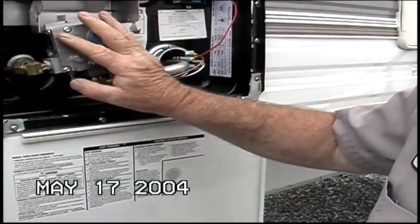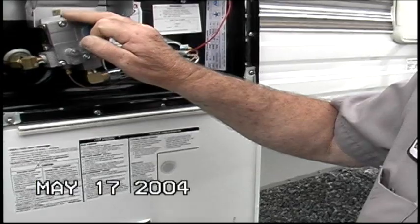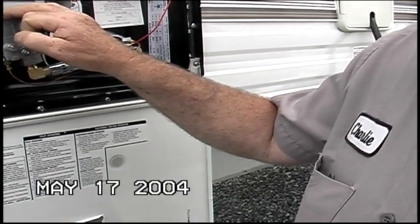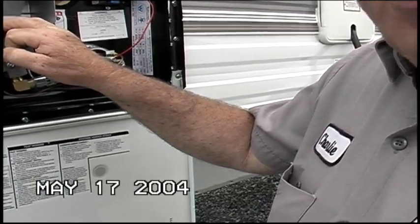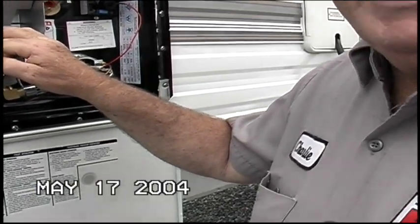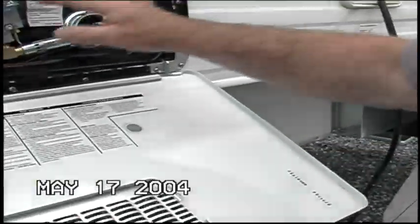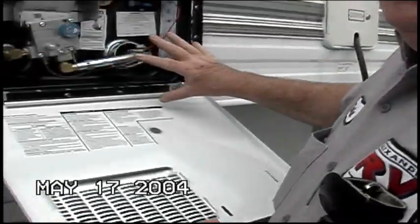You don't want to run your heater while you're traveling. You can run your refrigerator on gas when you're traveling. But when you come up to a gas station, shut it off. A tunnel shouldn't give you any problem. At a gas station you have a flame, with fumes right from the pumps, so shut off the refrigerator, just the fridge. The heater won't be on anyway.